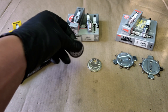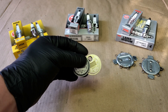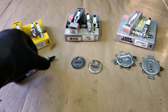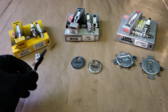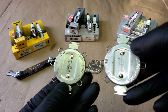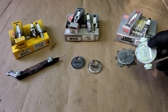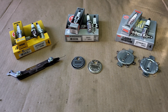On a final note, the coin style gapper is my least favorite — it's the cheapest and easiest to find but I wouldn't use it on iridium or small tipped spark plugs. The wire gap tool comes second due to how flimsy it is, but it's still a good option. The gap gauge tool is my favorite, with the only downside being that you only have six gap options to choose from. I hope you found this video helpful — please like and subscribe.